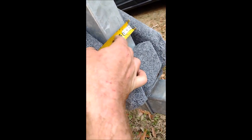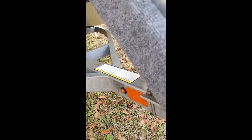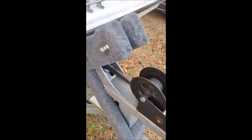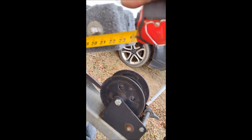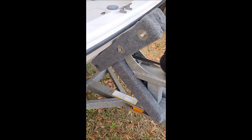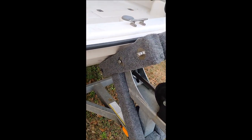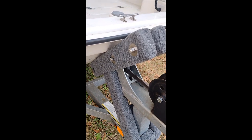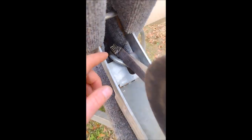I cut these two pieces about three and a half inches wide, just to screw in from here to here to keep it stable around the center post - it keeps the whole thing from wanting to rock, because it's going to pivot on the center bolt you put back in. For the length of the whole bunk itself, I cut these at about 23 inches give or take. You could go longer or shorter, but that worked well for me. The longest bolts my local hardware store had in stock were six inch.